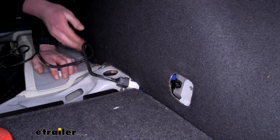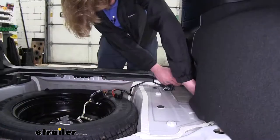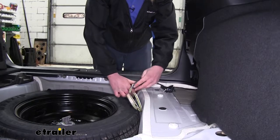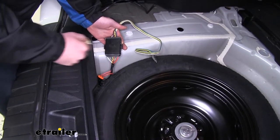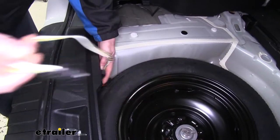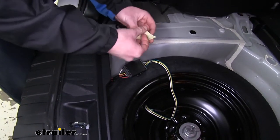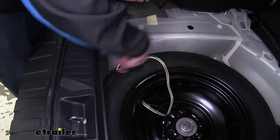We're going to route the new harness heading towards the back, just tucking it up underneath the side panel as we go. Tuck the wiring underneath that side piece all the way towards the back, continuing to tuck it around as it curves. We'll mount our module down here next to the spare tire. The module only comes with zip ties, and there's no wiring in this area to actually zip tie it to. Due to the short length of the connector, it really does need to go here, otherwise it won't reach out the back to connect to your trailer. I recommend you go out and purchase some double-sided tape, stick that to the back of your module, and use that to adhere it next to your spare tire on the back wall.